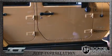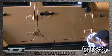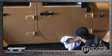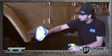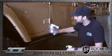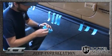Sit back and watch how easy our die-stamped Rocker Armor kits are to install. The first and most important step is to properly clean your vehicle prior to installation. We recommend that you use a non-oil-based wax and grease remover and finish with alcohol. Aside from cleaning the vehicle, the only tools you will need are some light-tack masking tape to help locate and position your kit prior to installing.